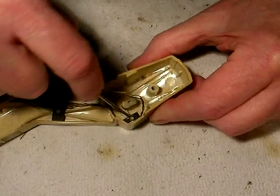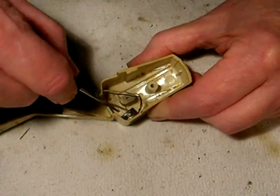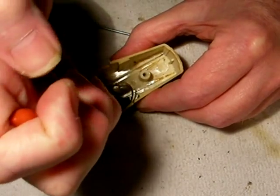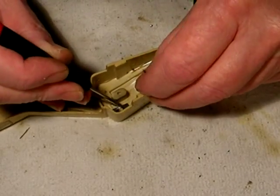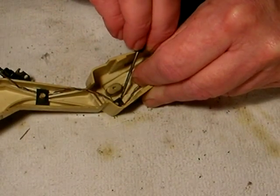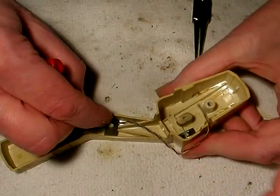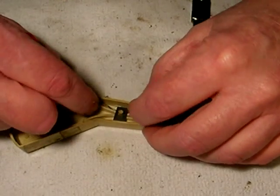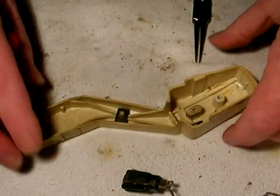It's coming — so is Christmas, I know. It's got to come off. I'll try the needle nose. It seems to be pretty loose now. We can also pry up on one side of it. Now that it's loose, we can push the wire underneath without cutting the wire and push it out. Pry up a little bit on the edge — there we go, got it out that way. This wire was cut when the arm had been taken off or left loose, and it broke the wire off right at the changer motor board. So I'm going to have to replace that anyway. All right, we got that out of here.